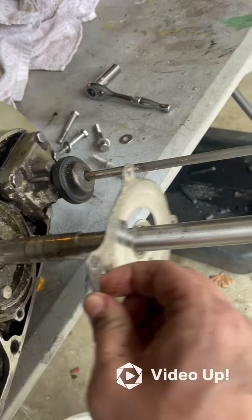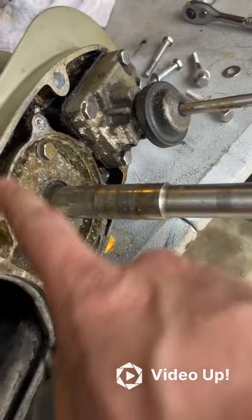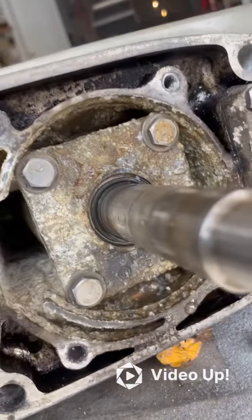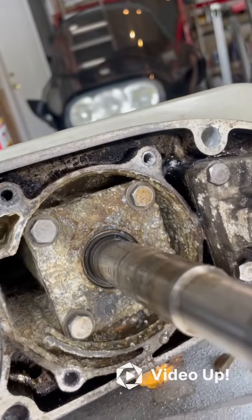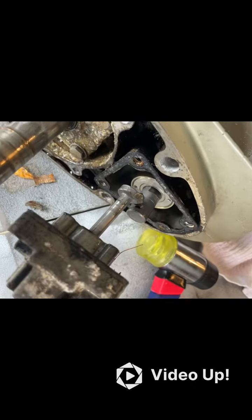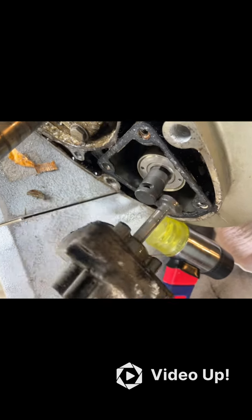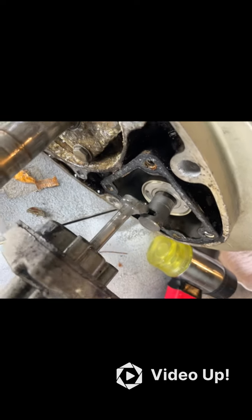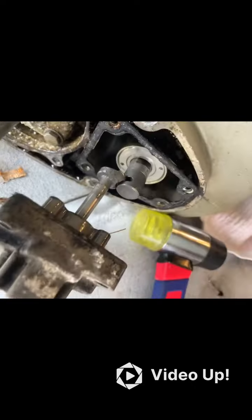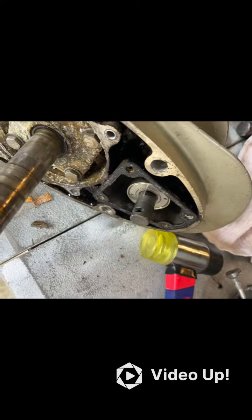This plate will also come off. In this model there's no gasket between the plate and the metal housing — that's normal. The saltwater damage you're seeing is from running it in saltwater even when flushed every time. Now onto the gear housing — still 7/16ths bolts, all four have to come out. When something's stuck with gaskets, use a rubber mallet so you don't break the metal and give a couple of taps. This shifter model is unique — these two pieces just fit together and line up without bolt fastening; pulling up is reverse.